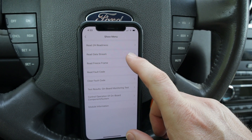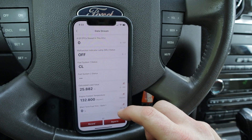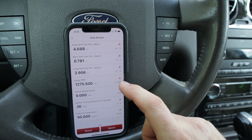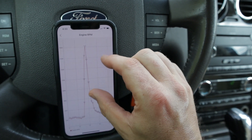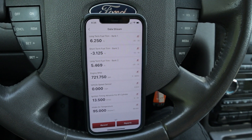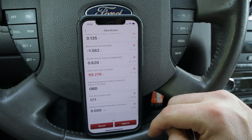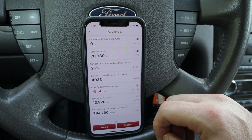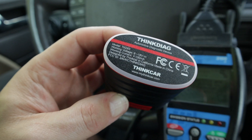If you want to see what kind of live data we can get, we can do the read data streams. We'll just check it all, hit that confirm button, and we can see we got one of seven pages. Scroll up and you can see the engine RPMs there. If we give it a little gas, we can see that it goes up. We can also hit this over here, which allows us to graph that. Give it some gas and we can see that our graphing functionality does work. You can record your screen or hit reports, which gives you basically a freeze frame of all the data on all of the pages. Definitely could use this for checking your oxygen sensor, as well as potentially even diagnosing a bad catalytic converter. So the Think Diag Bluetooth OBD2 scanner worked pretty well — pretty impressed with it. Let's move on to the next vehicle.